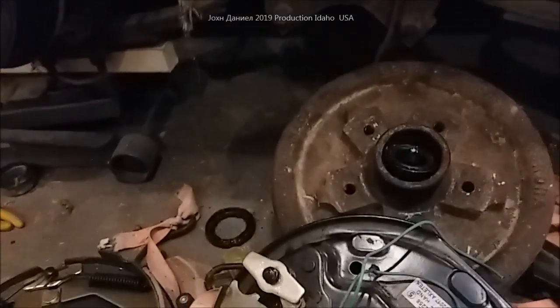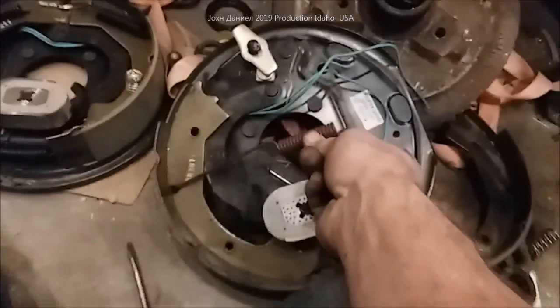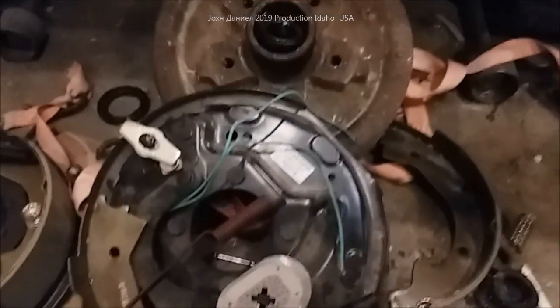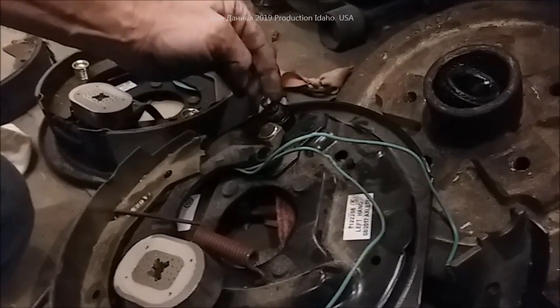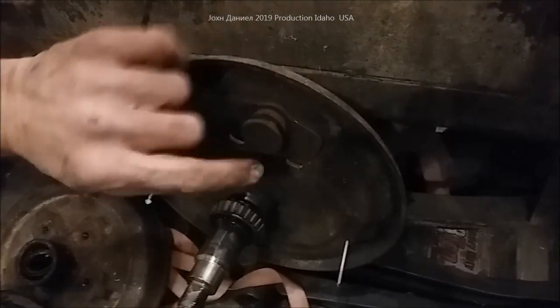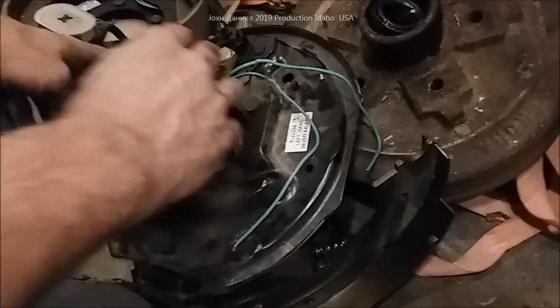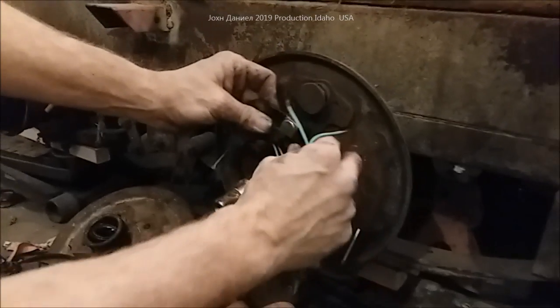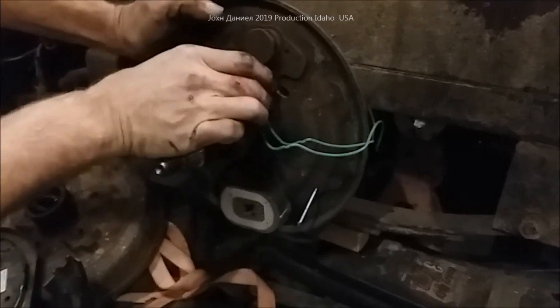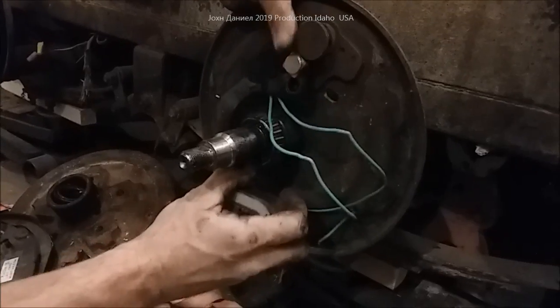Showing you how this one looks over here — you just want to copy that same process with the old spring. Take the old spring, look at how it's set up over here, and repeat that over here on this one, going to the same hole. The brakes are made to be used the same way; the distance to these holes are all the same. If you lift this out, take this little piece here off. You'll notice the difference between this one's brake cam and this one's brake cam — there's no point to put the springs on. I'm going to pull that loose, carefully remove this, and mount it on. The shaft pivot point on these is the same.